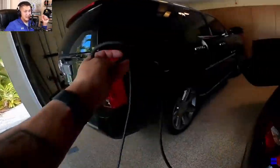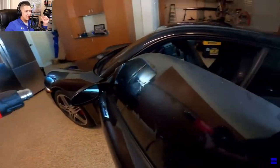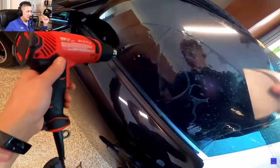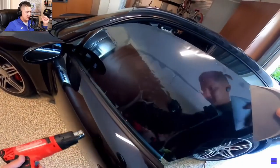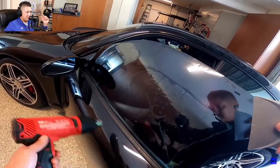These are pretty sizable fingers. Let's do this door — hopefully you can get a little better angle here. Bottom edge, back and forth, wait to get the air in underneath, and then just bring it up with it. Seal the bottom — you see how it's getting tight — and then just bring the heat up with it.